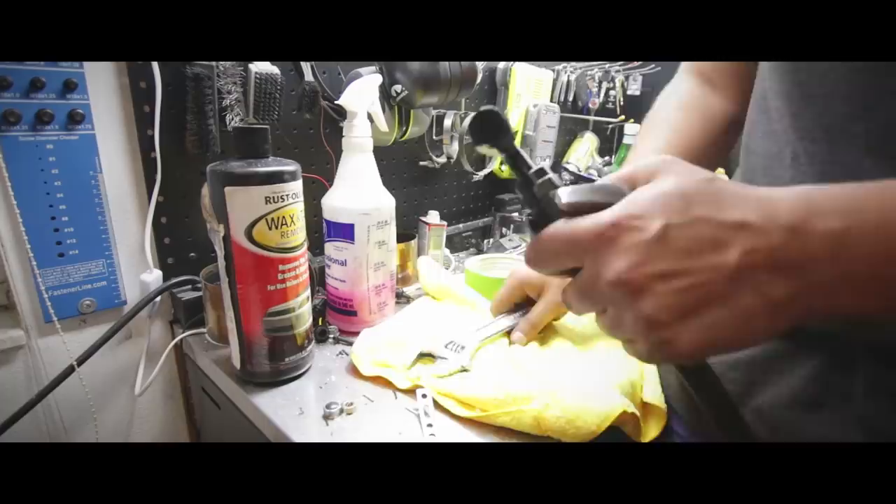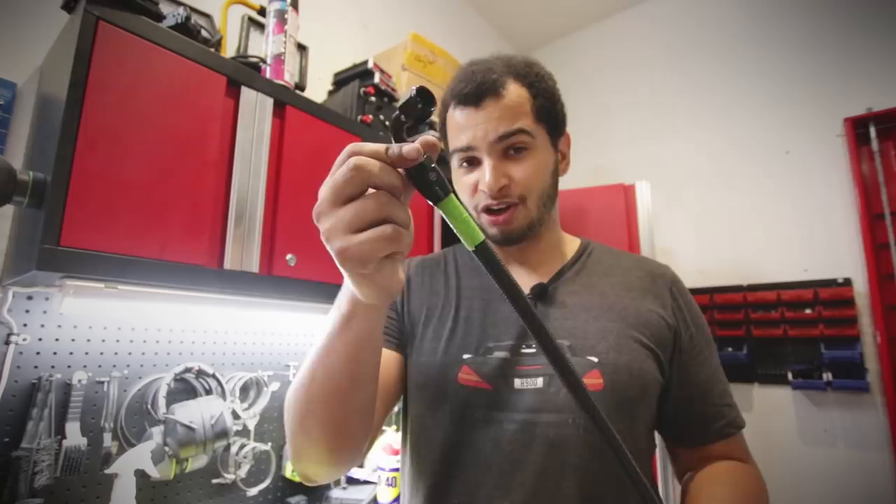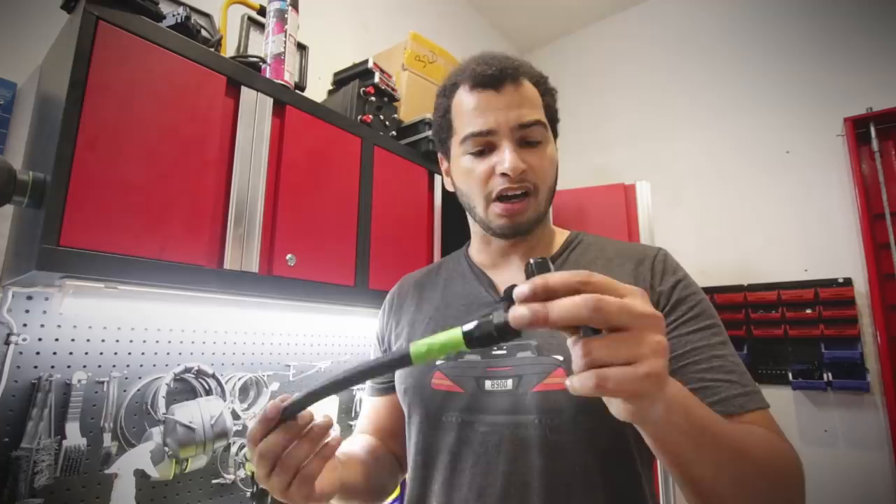If you were a little fuzzy on what I just did, I'm going to walk through step by step how to make your own custom braided AN hose. You can use these on vacuum, fuel, oil — basically anything. It's meant to be taken on and off as many times as you want, no weird rubber connections, just an aluminum fitting and a press fit. You can pick up the stainless steel hose and corresponding ends for your application at Amazon or any speed shop, and they're pretty easy to put on.